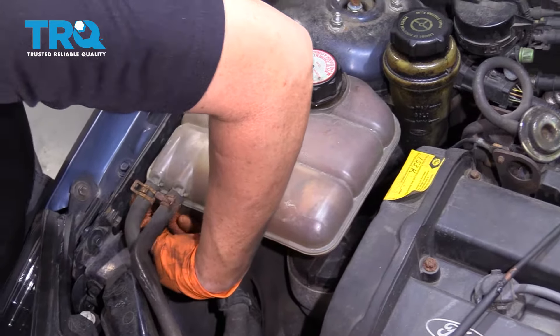Start from the backside where the tensioner and alternator are, because the belt is going to hit the ribs this way and then go up over that pulley. It might be a little bit easier to start it down here. Go over the alternator, down past the tensioner. The reason I started with the top two pulleys is so I can get the rest from down below. From the top we have it on the alternator, the bypass pulley, and the idler pulley.